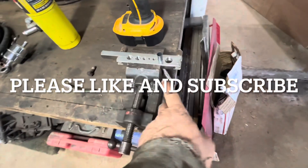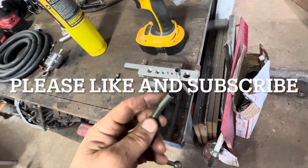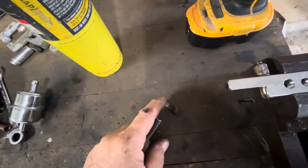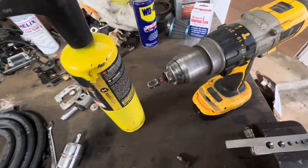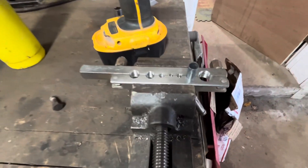I really like this fitting, so I ran my 3/8 fuel line supply. What I'm going to do - I started doing it already just as a little proof of concept - I'm going to take the map torch, heat it up, and I have a 3/8 bolt here. I just ground down the tip to a little bit of a point and put a 3/8 adapter in my drill. I tried it with the impact gun but because of the hammering it was getting crazy - the drill does it a lot better.